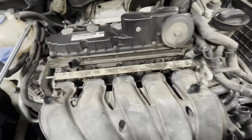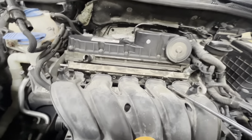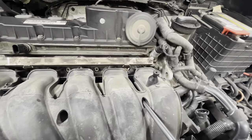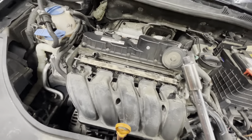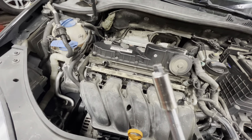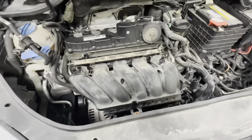With the car back down, undo all the screws for the intake manifold — they're all six millimeter Allens. Most are right here in plain sight and easy to get to. There are two through these holes in the intake that you run through like this to reach, and then another one you can only access through a hole. You need a pretty small Allen bit, or there's a special long Allen tool you can buy cheaply for this. I used a standard quarter inch drive adapter with a six millimeter — just stuffed some paper towel in to hold it — and undo them all like that.